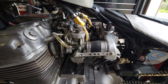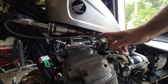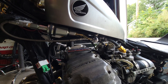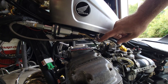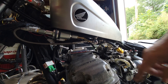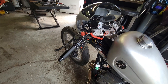The fuel system is still pretty much the same. Getting ready to change just the petcock — it now has a reserve and a close, which I wanted, but it doesn't flow enough fuel for the pump. The return side is good, but the feed side is lacking just a little bit. It's not coming all the way on pressure, and I feel like if I just put a little more flow out of here, everything will be good to go.